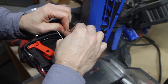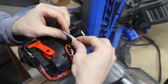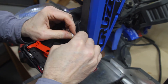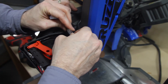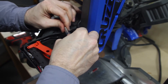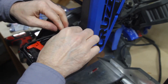I needed a way to splice the neutral and I did not want to cut any wires. What I did was bare the end of the 18 gauge wire and push it in underneath the insulating boot on the blade connector for the plug. Then I pushed the 18 gauge wire and the blade together into the socket of the connector. It all fit in there very nicely — it worked better than I thought it would. None of the factory wiring was changed.